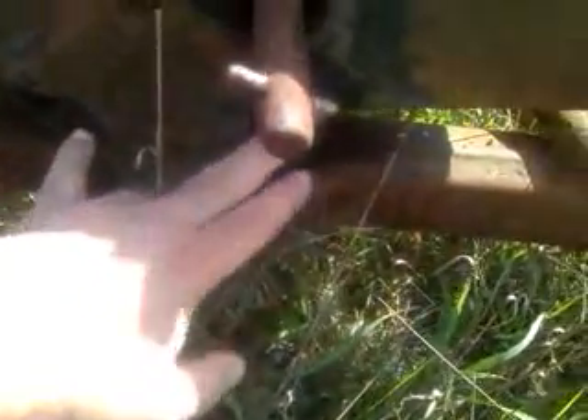See, there's a big hole. Down here — and then over here, those are the bottom two holes. This was a three-bolt wide front end: two down low and one up top. As you can see, the one where the top hole was is gone and there's a big hole in there. It looks like this bolt here broke off the bottom too. You can see threads in there but they don't look that good.